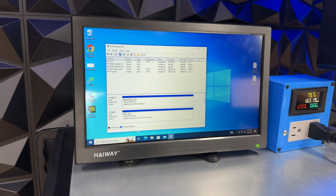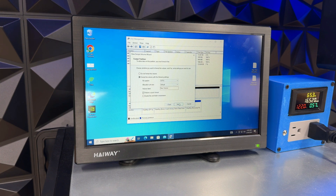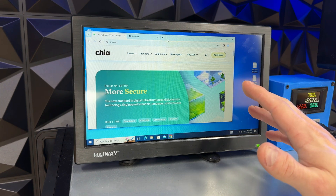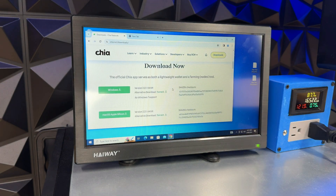Once you're up and operating, you're going to want to do a couple of things. You're going to want to make sure drivers are installed for your GPU, and also head over to Disk Manager to make sure all your discs are in place, that they're initialized and formatted. We can see our discs — this was the plots drive I was plotting on previously for the test rig, and here is our new one. It's showing about just under 15 terabytes in total. We're going to create a new simple volume, quick format, assign it E, NTFS is fine, and finish.